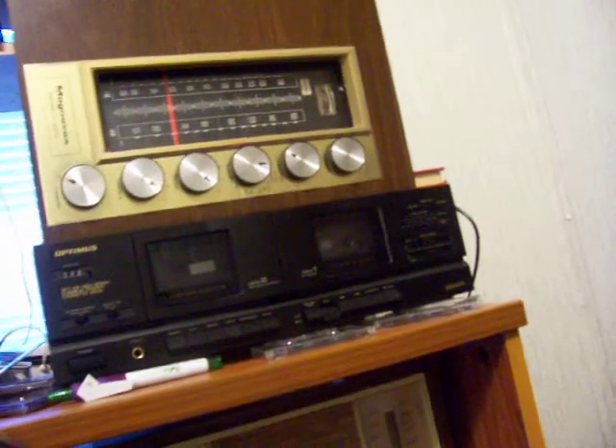The record changer appears not to be wired up to turn on the amplifier when switched, because I only see two wires coming from the switch. What I would like to do basically is just bridge the wires that would make this amp stay on when switched to record changer, and use the power socket that's on the record changer — just plug it into the wall and that would be it. Hopefully someone can help me. Thank you.